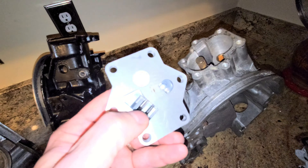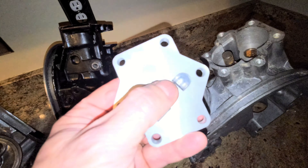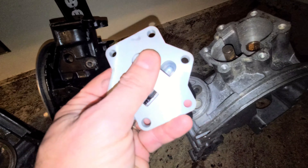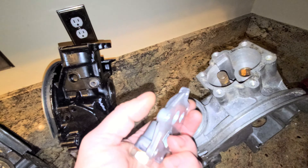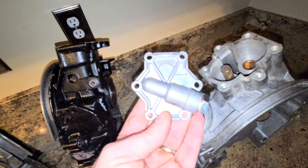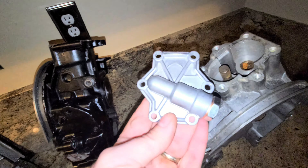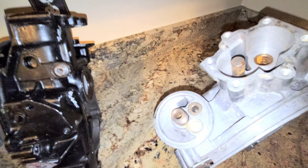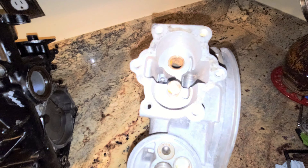The third and final oil pressure regulation on the system is your oil pump cover. The oil pump cover has a bypass built into it — if there's too much pressure, it allows oil to come back to the other side and that limits your oil pressure. That's why it's a good idea to just go ahead and buy a brand new one. You can clean them up, change the balls, plungers, and springs, but Gill sells these for $33 brand new at Opel GT Source. If you're spending two thousand dollars on your motor, buy a new oil pump cover — just do it.